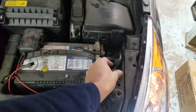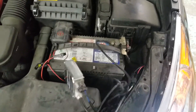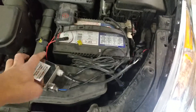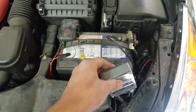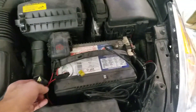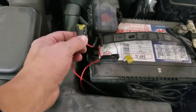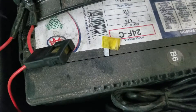We've seen the company trying to install HID here and did some LED fog lights for the customer. Everything here looks so messy. They use some pre-made harnesses that we already know are very flimsy. The wires in there are very slim, not really heavy gauge, very low quality. It is supposed to hold proper power but look, it actually got melted and the fuse burned like that.